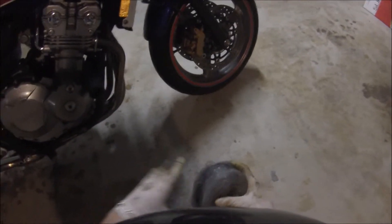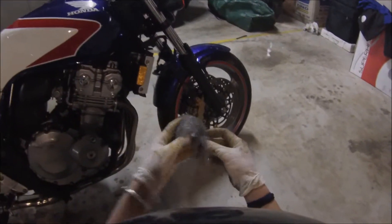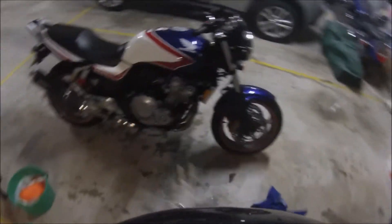Give a little squirt into the brake pad area and make sure you get all that stuff out that you put in there. Now for the exhaust pipes — you've got the coarse steel wool for this. Take about that much, roll it up into a little ball, make it wet, and still using the same solution — it's a little bit cold now but like I said, do this often and it won't be as difficult. The thing about using the steel wool is it will get the dirt off, but it also makes it easier for the weather to attack the metal, so you need to re-protect the pipes with a solution afterwards.